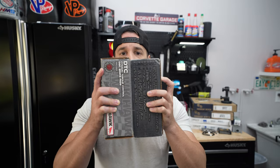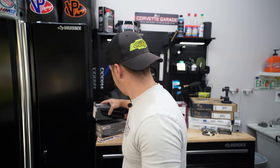We need to address one more thing before we go out there, and that's stopping. I don't want to go out here with the cross-drilled rotors that it has, which are known to crack under high heat, and since this car has been giving me all sorts of little issues I don't want to potentially put the car at risk — and more importantly myself at risk. So we're going with Hawk DTC 60s. If you're going to be tracking occasionally, maybe once every few months, you don't need to go as aggressive as these — you can go with the Hawk HP Pluses or something like that.